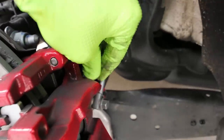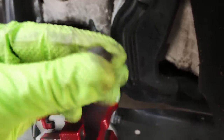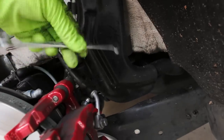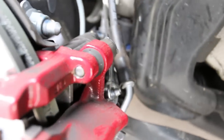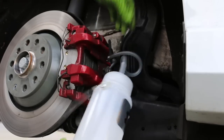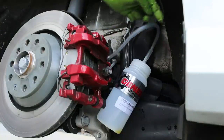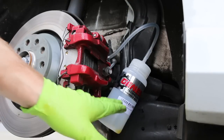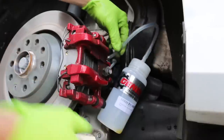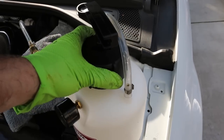With the wheel off, I can see the rear rotor. There's a nice little cap that protects the bleeder from dust and grime. After removing that, find your bleeder and the appropriate wrench. I've got my brake bleeder wrench over the top here. Now I'll attach the catch can — an ideal configuration has the hose at a higher point so all the fluid travels up and around into the bottom of the catch can. This also prevents air from getting back into the lines.